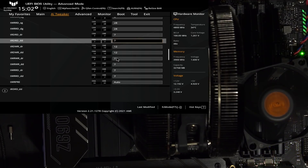That's basically it for the memory overclocking on the TUF, at least with this dual-rank Samsung B-Die kit. With single-rank memory sticks, 1T command rate works just fine and higher memory speeds are also possible. Though I don't know why you would want a 12th-gen CPU and then limit yourself to 16 gigs of RAM — if you're getting a 12th-gen chip you probably want 32 gigs, in which case you should be looking at either dual-rank Samsung B-Die or maybe single-rank Micron. It might actually make sense to run single-rank Micron in Gear 2, or as ASUS calls it, 1-to-2 ratio.